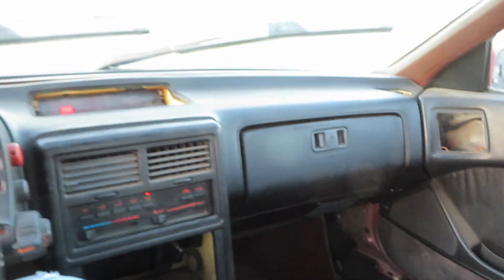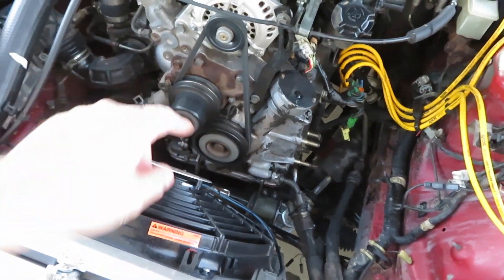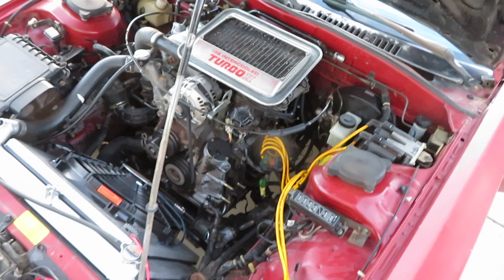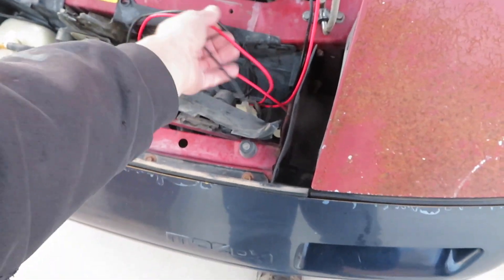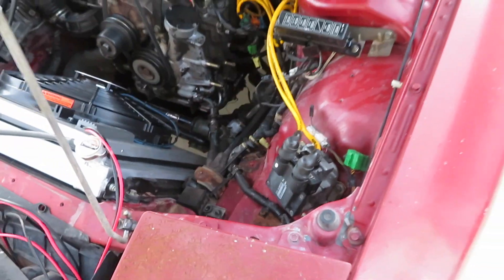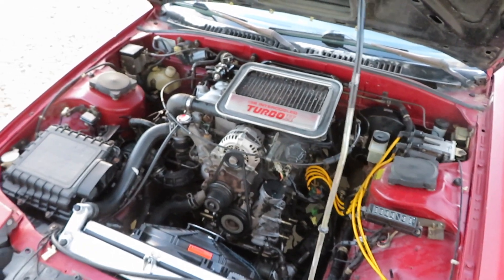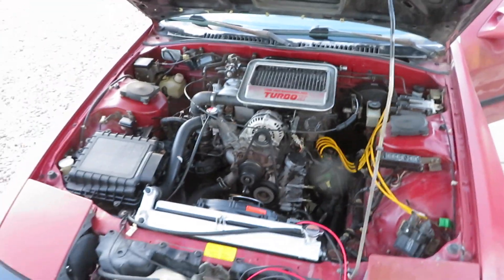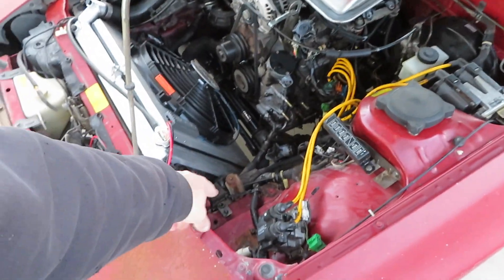I need to wipe everything down, but I'm so happy I could drive the FC again. She sounds so much better — don't have all that rattling from the clutch fan, the AC compressor, or the smog pump anymore. Now she just sounds super clean, like how a 13B should sound. In the next video I'll hook all the fan stuff up — I left a lug right here so I could just hook up the power wire. I want to do a different turbo eventually. The main thing I'm going to do is replace that master cylinder, which is leaking, and I'll replace both the master and the slave cylinder. I was just ripping her around and could actually do some nice corners without worrying about the battery falling into the fan.